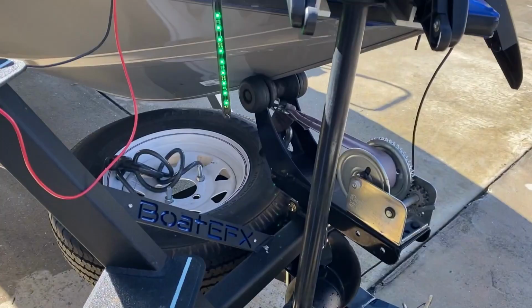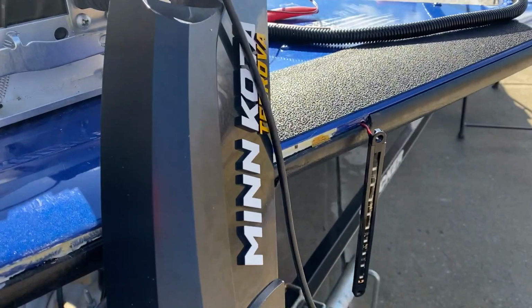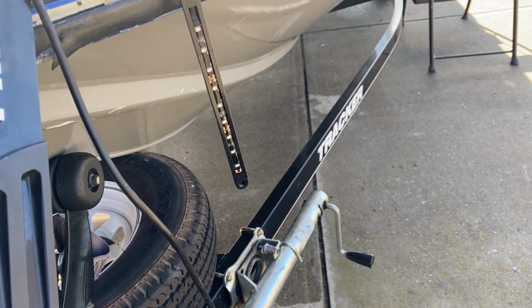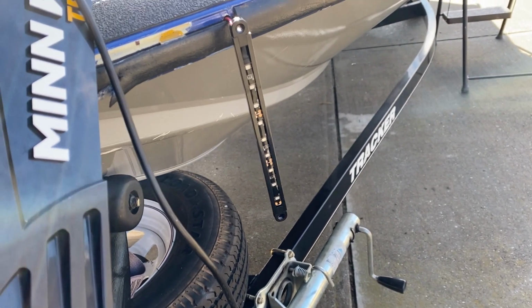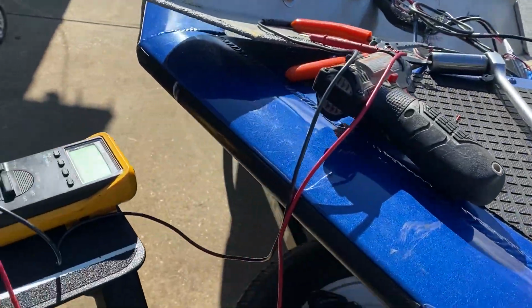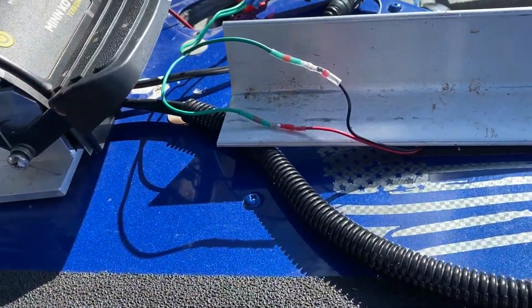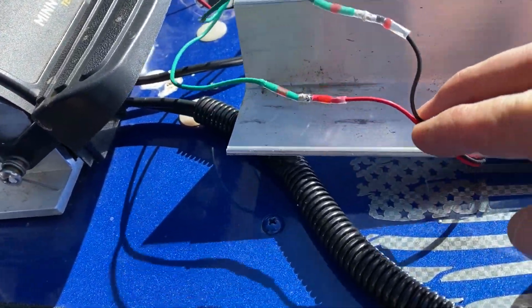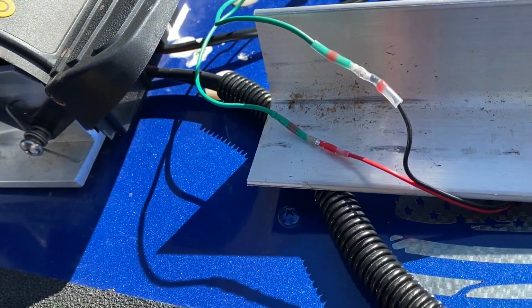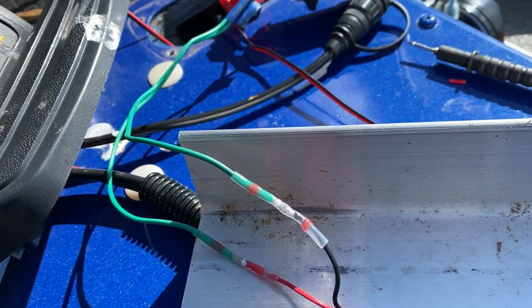The green and the red's not working, so the red didn't make a connection. Because the red did work when I tested it. So we'll have to figure that out. What had happened is I actually had it wired backwards. LED, they had to be positive to positive, negative to negative. You can't cross them. I also took a piece of angle to help deflect the heat. So those started up pretty good, and I've gone back and touched the other ones up.